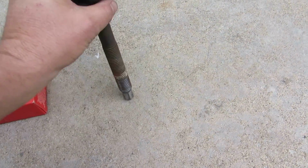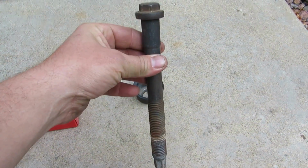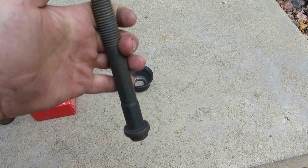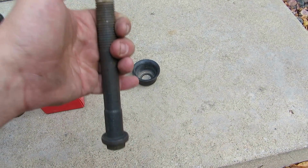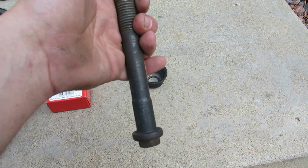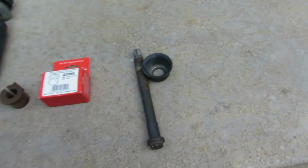Now on the original, this bolt here, along with that cap, was coming down in from the top. The other one comes in from the bottom. Put your new bolt through, put a hardened washer on, put the nut on, put the stud extender on, put your 2-inch lift on. Then I use the original cap nuts that were on here to lock the spacer down.